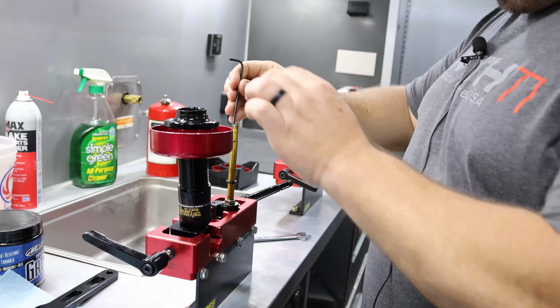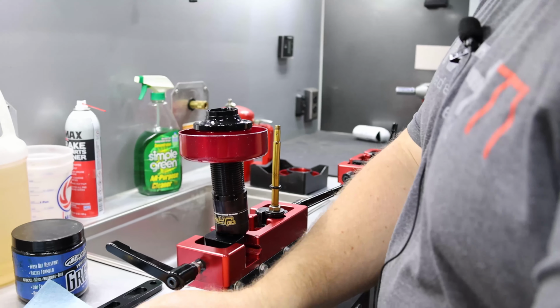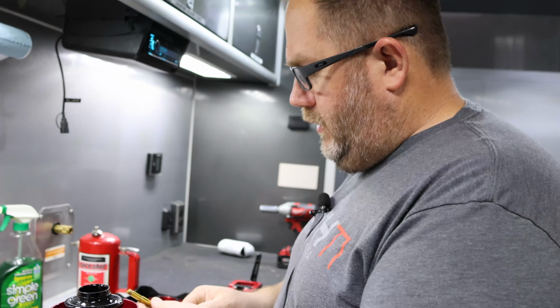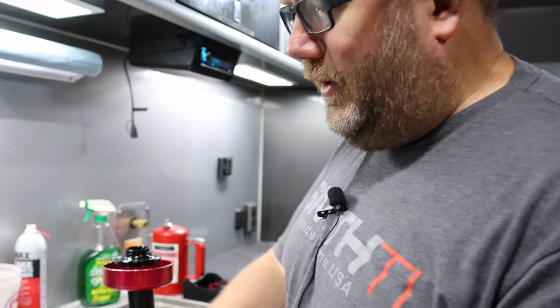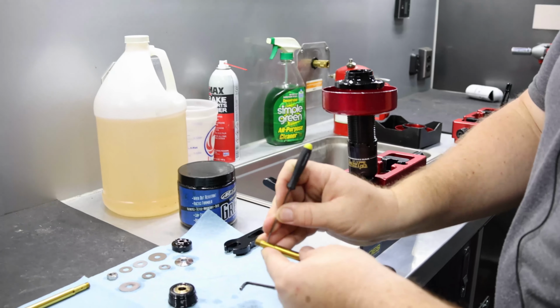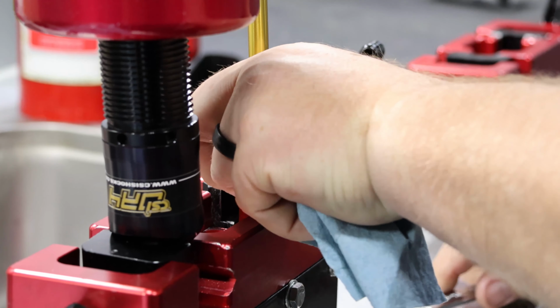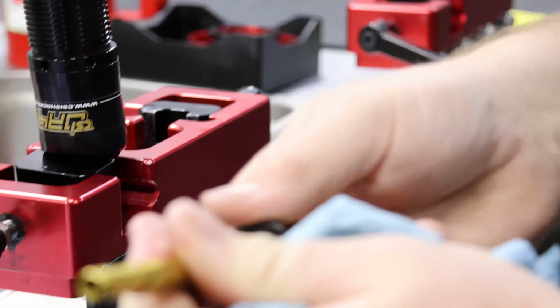So you'll take this jet off and then look down in there and see. On this particular build, there's no roll pin or anything in there. The next thing we'll do is take our 9/16 inch wrench and break that jam nut loose and screw the rod end off of the shaft.